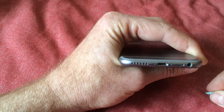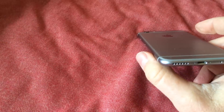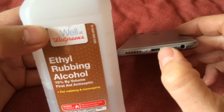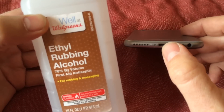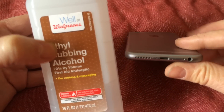Just dig out the crud and then try it. If that doesn't work, it's possible that the little connectors have become dirty. You can put just a little bit — not a lot — of rubbing alcohol on them. Don't use water because it'll ruin your phone and void the warranty. There's a water detector strip inside, and if Apple sees it's turned red, they won't honor the warranty. So use just a little rubbing alcohol and rub it on the contacts to clean them good.